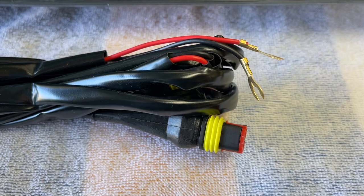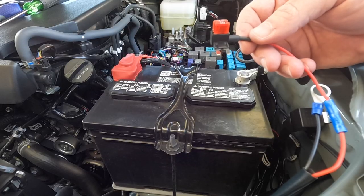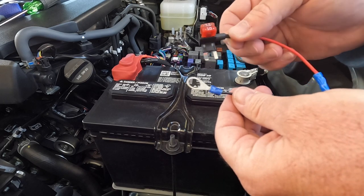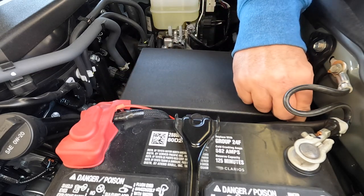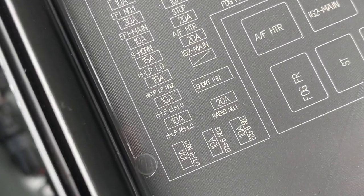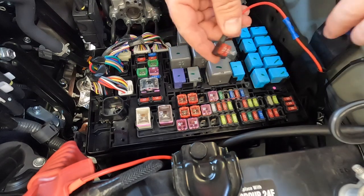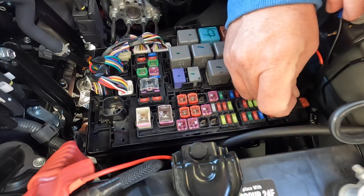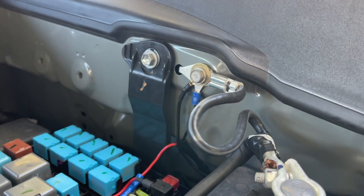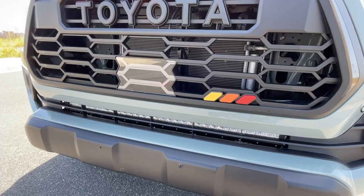Now for the add-a-fuse. I pre-routed the wire harness and found that it was way too long and cut off about 18 inches of total wire. Once cut, I stripped and crimped on the add-a-fuse to the red wire and added a new looped connector to the black. Remove your fuse panel cover by depressing the three tabs holding it in place and locate the 10 amp fuse labeled H-LP RH-LO. Remove this fuse and place the add-a-fuse in this slot. I opted to place a 10 amp fuse for the bottom slot and a 7.5 amp fuse for the Raptor lights in the top slot. Once connected, attach the black wire to the ground bracket on the sidewall of the engine compartment. Now every time you turn your full lights on, the Raptor style lights will be on. I didn't want them running with the daytime running lights.